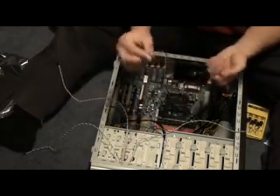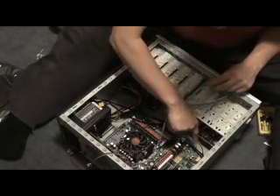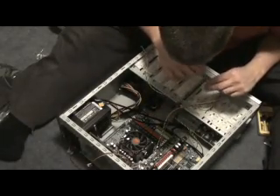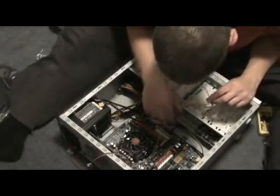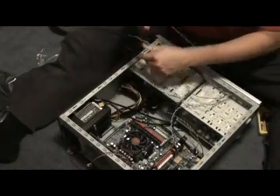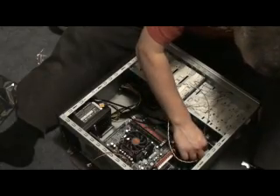Reset SW — reset switch. If you look on the edge of your motherboard there's a spot where you can plug in all these multiple things. They're all color-coded. There are some little pins waiting for one of these. This one says power switch — on the motherboard it says P-W-R-S-W. Hard disk drive LED goes directly underneath the power switch. It's intuitive.